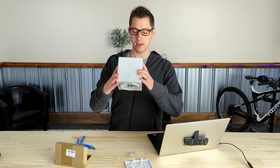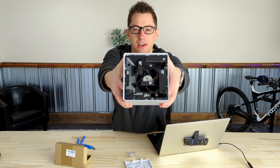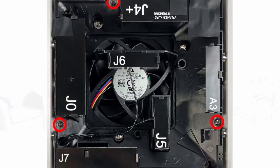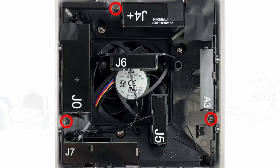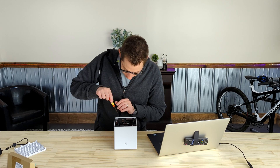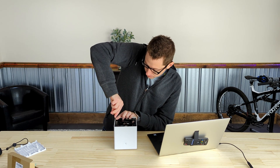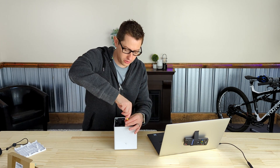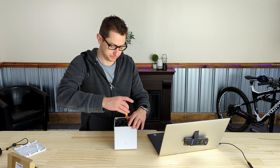The top's off — look at that. There's the inside of the top of this Verizon gateway. It's actually got a little fan. Next step is to remove all these little blue plastic shavings everywhere that my pry tool sacrificed for science. The next step is to remove three Phillips head screws located below the top cover that secure the outer cover to the inner enclosure. I see those — pretty easy to locate. I just need a screwdriver. You would think I'd have all my good tools around me and be prepared for this video, but instead I'm not. We're just using what we can find — but isn't that how you do projects at home anyway?